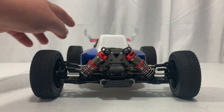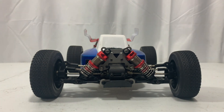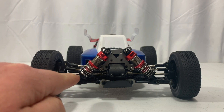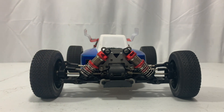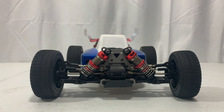The first visible change I made was putting the original spoiler back on but cutting the whole back of it out — that reduced drag. Then at the front I added droop screws and cranked it down until the driveshaft was level with the ground. All four shocks I cranked down to the very bottom to stiffen it up. This seems to help out a lot — it's still going nice and straight. I also adjusted the toe and camber. Then on the ESC, I reset the throttle and reverse — the neutral trim wasn't set right from the factory. I went in and recalibrated it, and that seemed to help a lot.